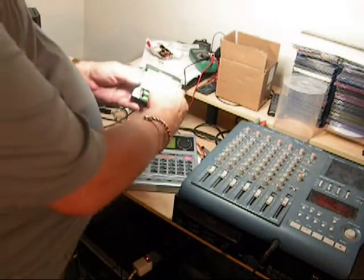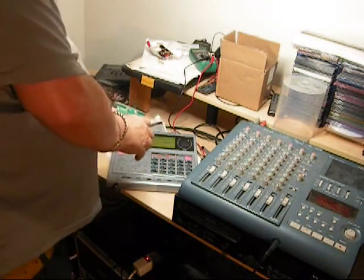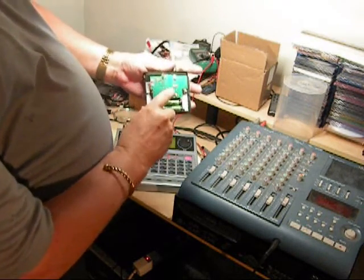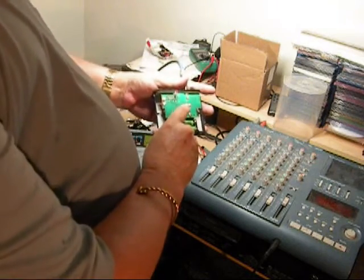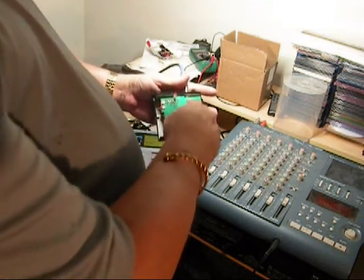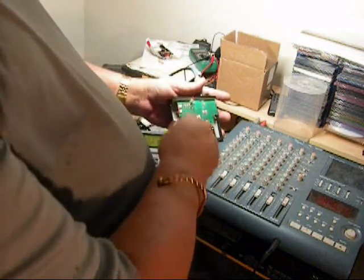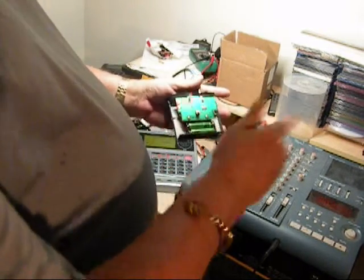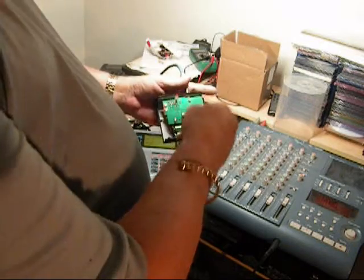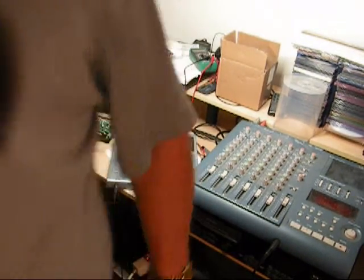Okay, we'll look inside this thing. There's a little push button in there — see, nothing happens. But when you go ahead and put your jack in there, the light goes on and goes off. Well, it turns out the switch has nothing to do with the light. It's not giving three volts — it's just turning the light on. Basically, all this circuitry and all this light does nothing. It does not give three volts to the connectors like it needs.